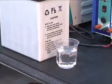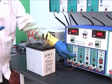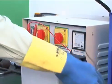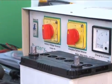After 24 hours, if the water level has decreased then add some distilled water to restore the level. After that, charge the battery again for 24 hours. Once charging is complete, remove the battery from the charger and let it cool for another 24 hours.